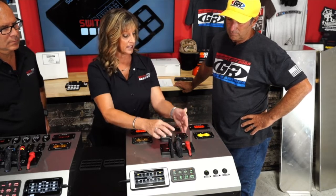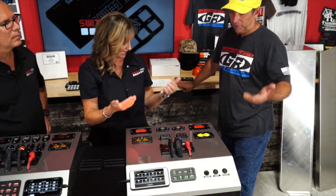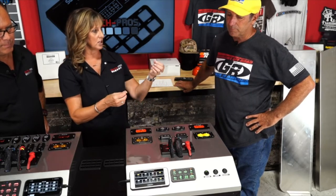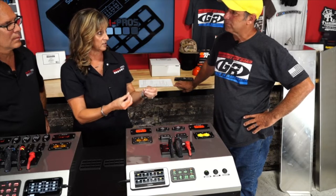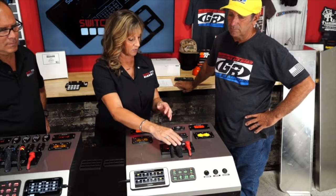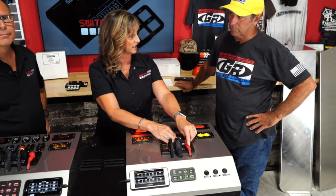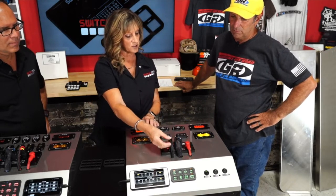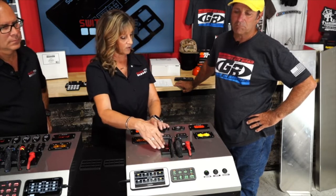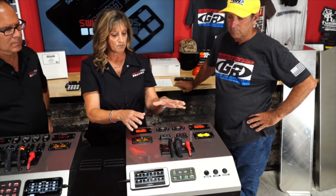The system comes with a fused battery cable — the only fuse needed is a 125-amp inline fuse right in line with the battery. The communication cable carries signals from the touch panel to the power module, and the power goes out to accessories through the output leads. The Racer Force 12 was built due to demand for higher output, more inrush tolerance for running fans, and additional amperage.